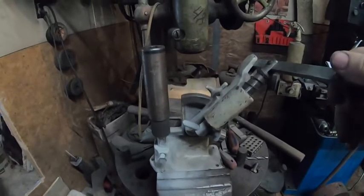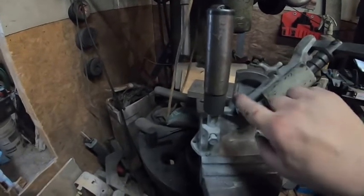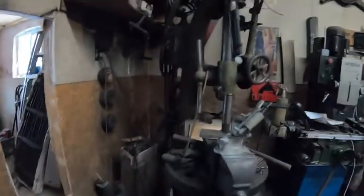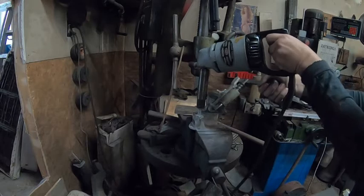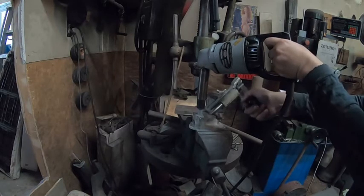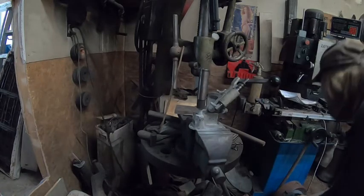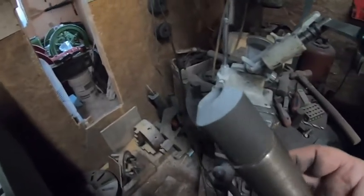Here's my setup for dressing valve stones. I put the special drill on here and then spin it and move this back and forth. I have it at a 45 degree angle. It has that diamond tip and it redresses to what I want — 45 degrees. Don't worry about the mess, you'll be cleaning up one day. Just working on a secret project here. That's a nice new 45 degree cut.